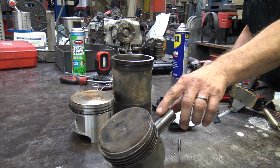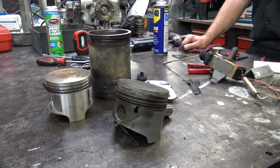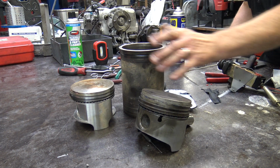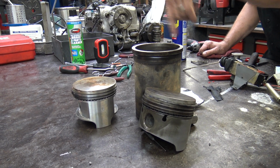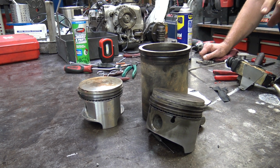Okay, so generally, if you've got a bad piston, normally they'll overheat and crack and make noises. And by the way, this engine was pretty noisy, very noisy. So generally, when you do a piston, you do a liner, and then you cut it to fit, and there are rubber seals, and that's about $2 grand, all in. Per cylinder, there's 8.